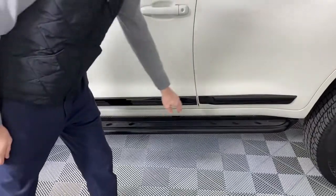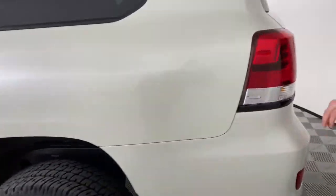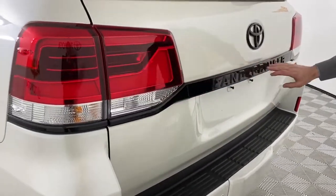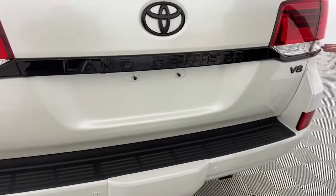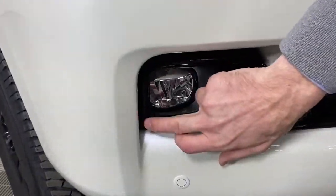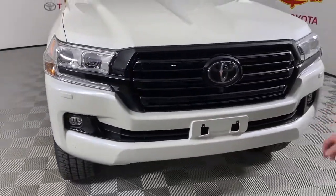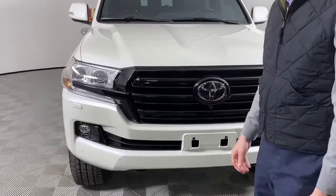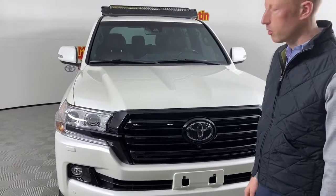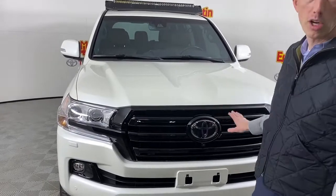There are about 22 pieces that we take off the paint — the lower door molding, the pieces behind the tail lights, the V8 badge, the Toyota badge, and the trimmings that come along with it. In the front, the lower cowl surrounds are two pieces, and then the headlight wings and the grille. Everything's taken apart, sent to the body shop, prepped and painted with PPG EnviroBase Toyota paint — 218 Crystal Black Toyota paint — and then clear-coated, so it should last forever.